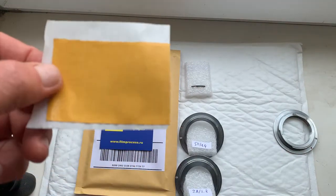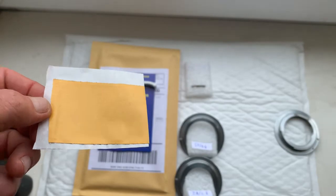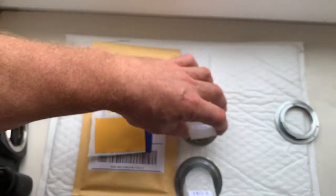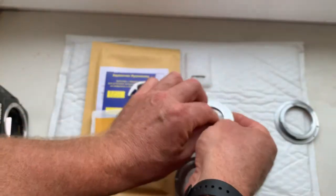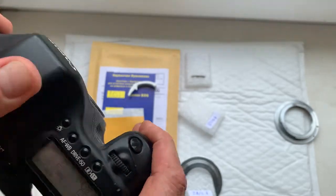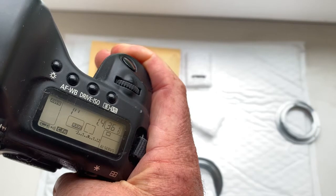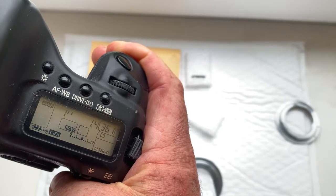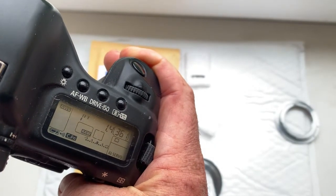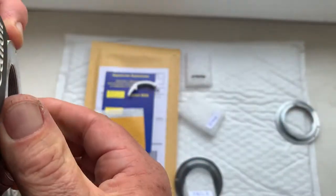A little piece of double-sided adhesive tape is sending with the chips. Chip number two: this chip is pre-programmed, focal length is 50 millimeter, aperture 1.4, delay time to enter program mode is one second, focus trap mode is on.